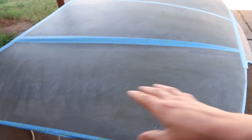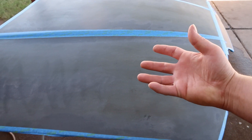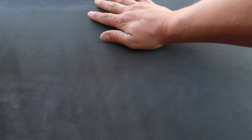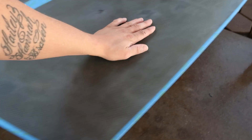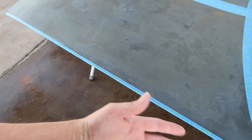Wet sanding's not doing anything - there's a bunch of staining going on inside this hood from oxidation. When you first buy a carbon fiber hood they don't come with clear coat on it - it's just gel coat that hardens over the carbon fiber fabric, giving it a shiny appearance as if it's been clear coated, but it's not. To keep these things looking nice long-term you need to put a clear coat on it.